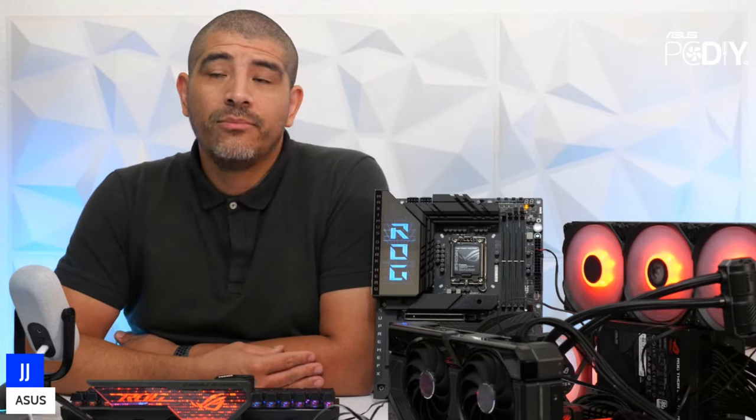Namor is asking, what if I want to have an improved system? I don't know what you mean by improved system. Just because you have the new UEFI doesn't mean that you improve anything. Again, UEFI updates might not even provide you any actual benefit, right? If that UEFI update incorporates new interoperability and compatibility support for, say, a new M.2 SSD, and you don't have that SSD in your system, it doesn't do anything for your system. So you're not improving performance, right? There's zero net benefit. Even if we include DRAM overclocking improvements, but your system is underneath the overclocking threshold where we're making the improvements, again, you don't get any performance uplift, right?